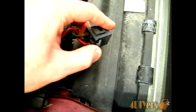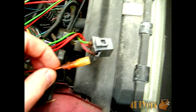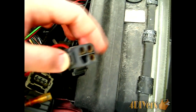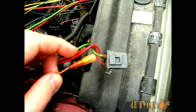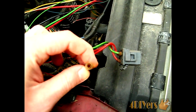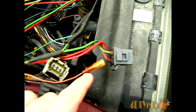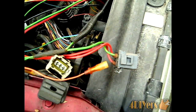When checking the terminal itself, sometimes in these plugs you can remove the terminals out. On this vehicle I've already had this one removed — this is actually the wire I sourced out with the ECU. Sometimes you need a special tool to pop the pin out. These terminal connections can corrode and need to be cleaned, or they can heat up and expand, so they need to be closed up a bit to fit tighter. Moisture can get to the crimp connection and actually break the wire off.